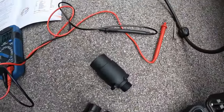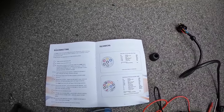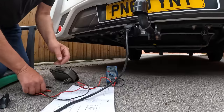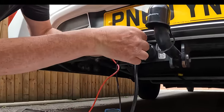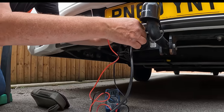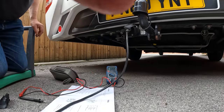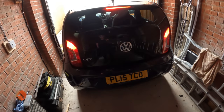So I bought a new plug — went to Amazon and got one. I thought I might as well change the plug. But just before doing that, I plugged the old plug in and put my multimeter leads on it to see what was going on — and I was getting a voltage. I went around the back and lo and behold the brake lights were working. Something a bit dodgy in that plug, I thought. I've had problems with that plug before.